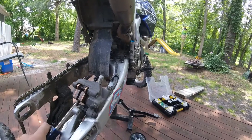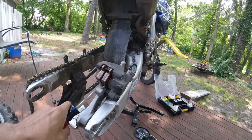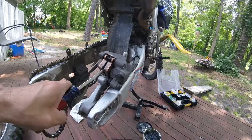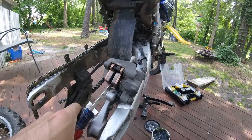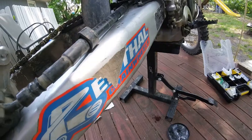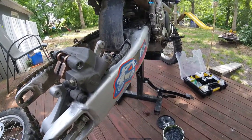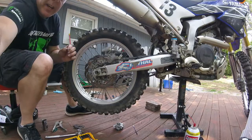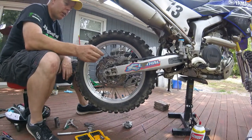The pistons still out a little bit - I'm gonna clean that first and then spread them open carefully with a screwdriver to push the piston back in the bore. Very gently slide them open enough and push with the screwdriver - not contaminated - enough to get the disc in there. You can see the piston going back into the bore as I do that - you've got to do it evenly and slow. That apparently developed a fluid leak, so I'm gonna pause here, take that top off, and hopefully I didn't break a seal. Welcome back - caliper clip situation sorted out.